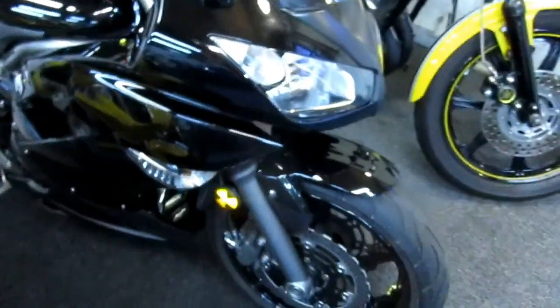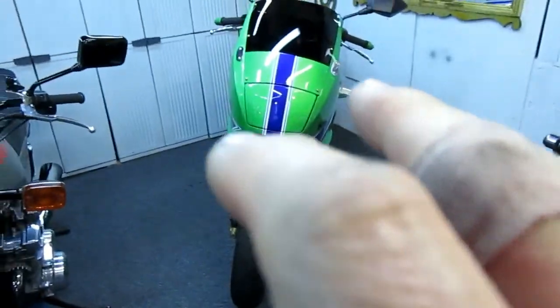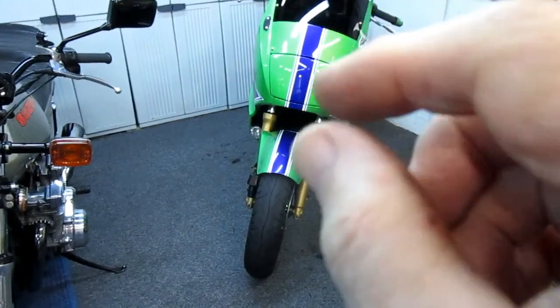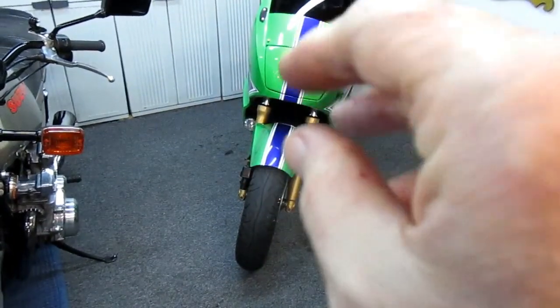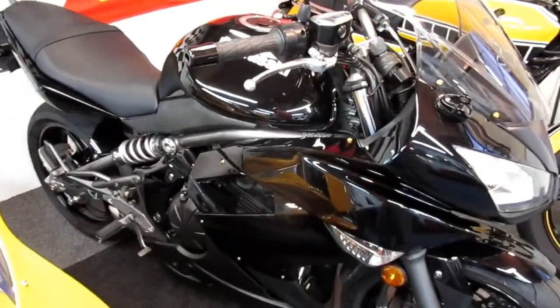Of course, I'm going to have to match parts that don't get painted, and hopefully we'll figure that out. But we have a chance today because of the green part, and I've just got done painting with the small 4 ounce gun. I cleaned it with acetone, and I'm going to try putting the clear in the small gun and see if the little sparkles come out. Then I can do a test on a piece of aluminum that I have, and if that works, I'll have at least that much when it actually comes to matching this.